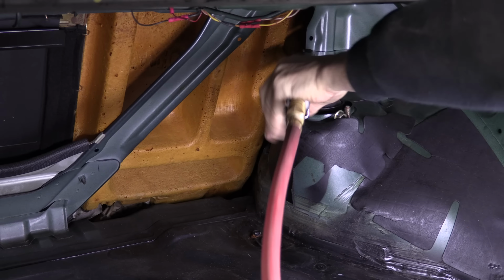To remove the heaviest part, the rear diff, the axle cups need to be separated first. There's two different axle designs on all-wheel drive DSM era cars. There's the three-bolt axles like these that use a smaller shaft, really easy to spot because of their triangular shaped flanges on the axle cups. The three-bolt rear axles came specifically on cars built prior to May of 1992, so there you have it. If you'd rather read the production date off the VIN tag in the door jamb or the engine bay, if you can't climb under it and look, cars made from May and beyond got the four-bolt units.